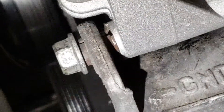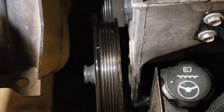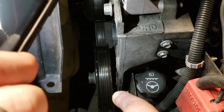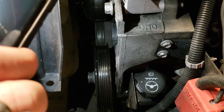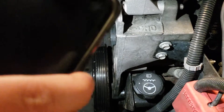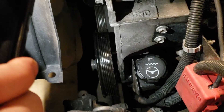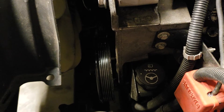I think I know why your stuff is squealing. Look at the first rib right here - it's indented. How bad? Look, you can see it better there - that first rib is squished. Yeah, that could be hitting the belt and squealing every time that goes by. We bought belt conditioner and that made it worse - it sounded like a grinding noise. I really think that's it, because the rib is bent out right there, and it could be hitting the inside of the rib and squealing every time the belt hits that one spot.